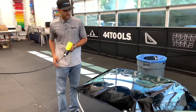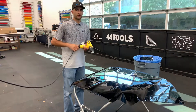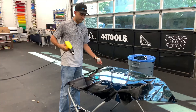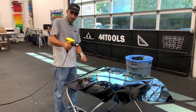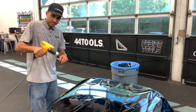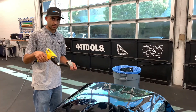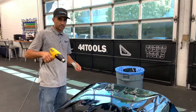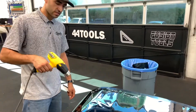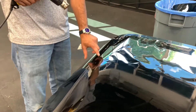There are a couple of things I want to talk about. Just like with any other sport, you can show someone, you can demonstrate, but no matter what, even if I show you exactly what to do, it's still going to take practice because everyone has their own way they're used to doing things. Pay attention to how I hold the heat gun — I'm not really grabbing with my whole fist. I'm loose and I'm gripping it lightly. It's all in the wrist; I'm not moving my whole elbow and my whole shoulder. It's actually more relaxing — it feels easy. If it feels hard, you're not doing it the right way. I keep it moving rapidly but with just small little wiggles, and that way I can get really close to the film without being worried I'm going to burn it. I like to get close, but not for long.